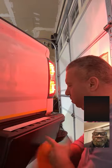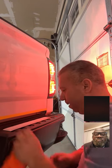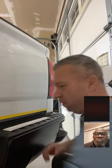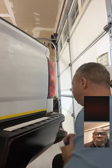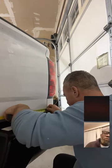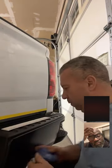The reason being is because the VOC laws drastically changed in 2010. They then changed again in 2015 and then again in 2018. The VOC laws limit the amount of volatile organic compounds that the manufacturers are allowed to put in the clear coat. Every time they take those VOCs out, the clear becomes more and more susceptible to solvent. So they had to re-engineer the strength back into the clear coats, and they do that through hardness.